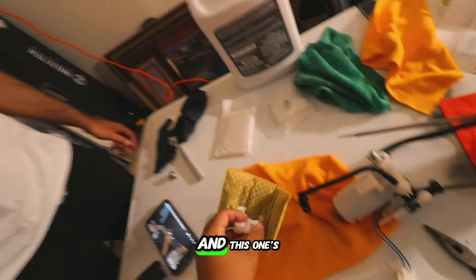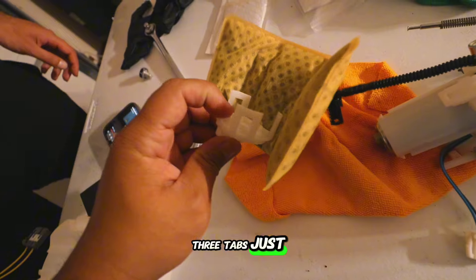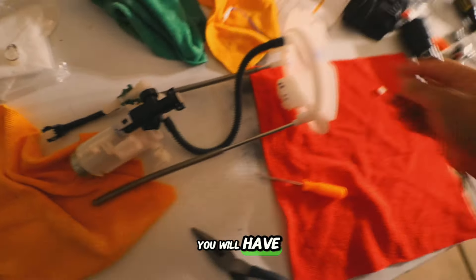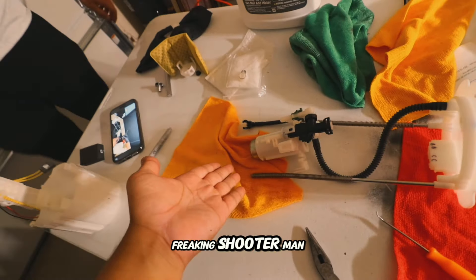This is the fuel sock, guys, and it's at the bottom of the fuel pump — three tabs, just use a pick. At the top of the fuel pump you'll have a blue harness: press it out, take it out, and then remove the fuel pump itself.